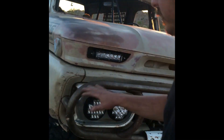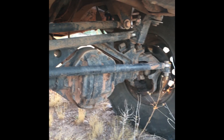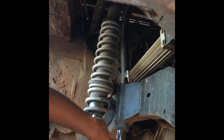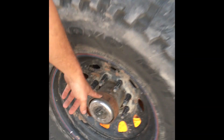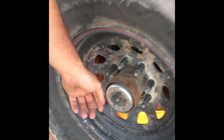Custom bumper, custom modifications. It's running a '97 Ford F-350 front axle — was a dually Dana 60, ball joint knuckles, plenty strong enough for what we're doing... kind of. Single two-and-a-half inch ADS coilover, two-and-a-half inch hydro bump, two-inch stroke — that's literally all that's in the front. There's no fanciness other than the valving — that's the secret sauce. Proof it used to be a dually — the wheel mounting surface was machined off and modified. On any other factory Dana 60 hub it would still have a flange on it.